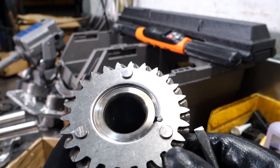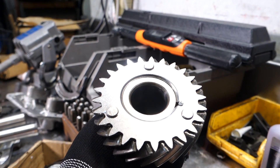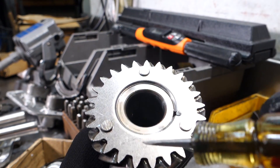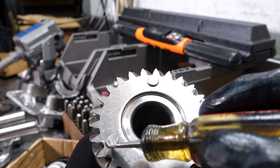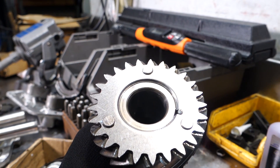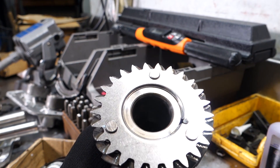Second Design Factory Muncie M20 counter gears have this anti-backlash plate on them. It's got three rivets. If you notice that these rivets have scrape marks in them, that's because they've been getting loose and running into the front of the case. When I build these transmissions I always take this plate off.